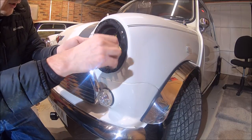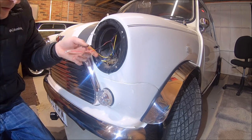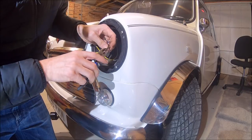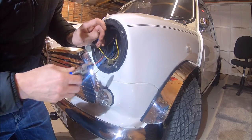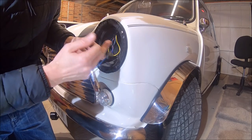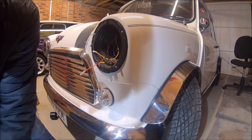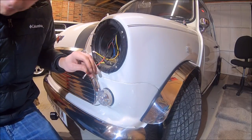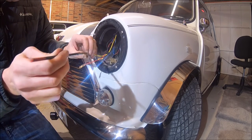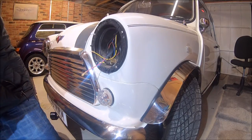So that's our red and our yellow wire. There are headlamp wires. So we are nearly there. We'll just close up these terminals so they're a snug fit. On your headlight, the whole block should be there, it should be okay, it's just because this one's broken. And now we just got to fit that headlamp in. I'll get a bit fussy about these things, but I don't like things corroding, so we're just going to put a bit of grease on these connectors here. And we'll do the same with these, but on the headlight.